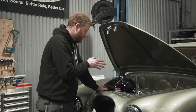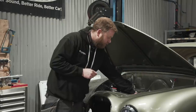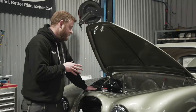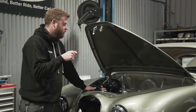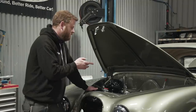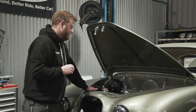The power steering pump was another detail. We really liked the fact that on the Toyota engine it has a quite vintage-looking pressed metal reservoir for the power steering pump, so we've retained that. The only change is where it had a push-on barb for the oil return line to the reservoir - we've replaced that with a threaded fitting, and moved its position so the line clears where our airbox is.